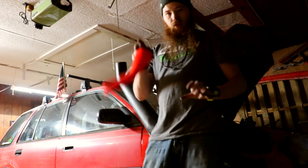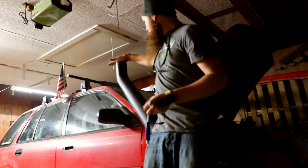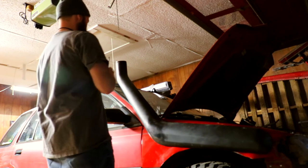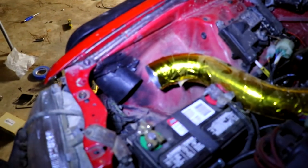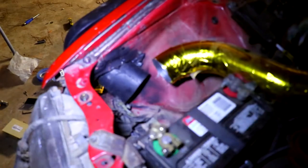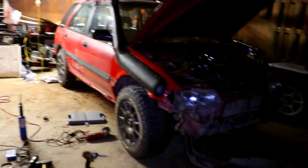As far as installing this filter, it literally just drops in the end here. It's already pre-oiled from Uni, so that's pretty awesome. It just drops in and sits on top like that. You can get your breather basket and go ahead and tighten your clamp down. On this video I'm not going to go super into detail on how to hook your snorkel directly into your intake pipe, because that's something you're going to have to figure out on your own — everyone's application is a little bit different. I have this cheap eBay air intake and I'm going to order a 90-degree silicone elbow to put on there. But yeah guys, that's pretty much it — it's looking pretty sweet, I'm digging it.